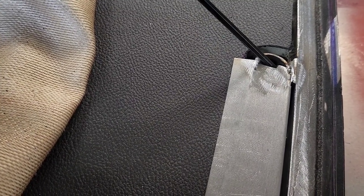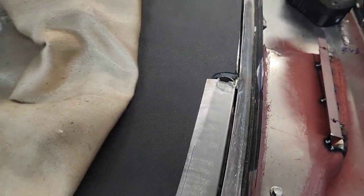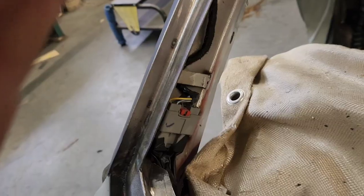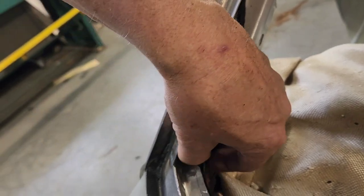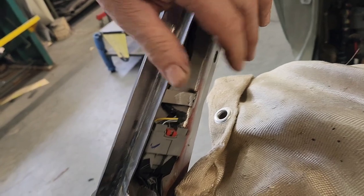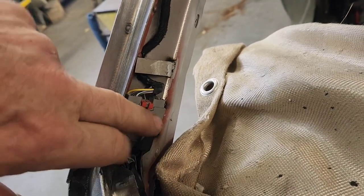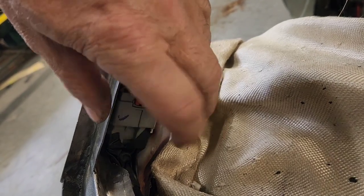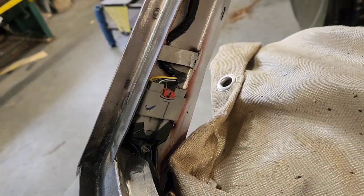I just got this one tightened in - you can see it starts to grip down on the front edge, keeping it from springing up. That's how I'm retaining the front edge. Also, while I'm working on the dashboard, there are some wires that come up through the dashboard on the corner over here and go up the A-post and into the headliner. I want to make sure this plug is always available above the dash line, so I've put a plate in here with a drill hole and popped it in there. If I ever have to unplug it, I can just pull this out and free up the upper harness. I've got to do the other side like that too.